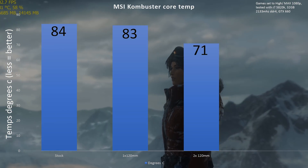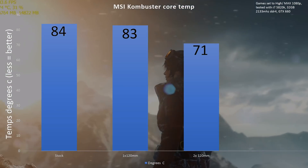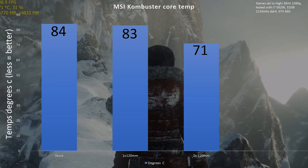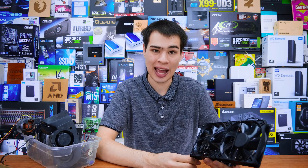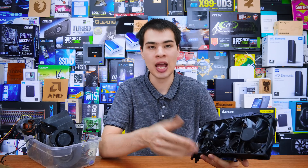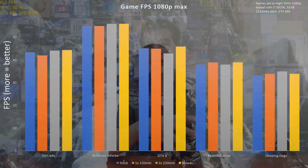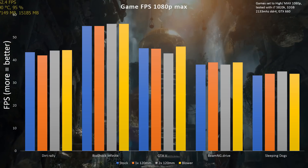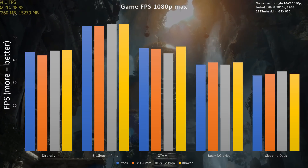We actually got on average 10 degrees or better in terms of cooling performance, even though the fans themselves were spinning at the lower setting around 600 to 700 RPM — way lower than the 1300 RPM that the GTX 660 Windforce edition runs at. Under load, the Windforce GTX 660 screamed really loudly with the fans maxed out to keep it at a reasonable temperature, whereas this setup just hummed along at 600 to 700 RPM. Gaming-wise, FPS was not affected because these particular cards don't boost up anymore if they're in better cooling situations, but they just ran cooler, meaning you could probably turn up the overclocks a little bit more if you were into doing that.